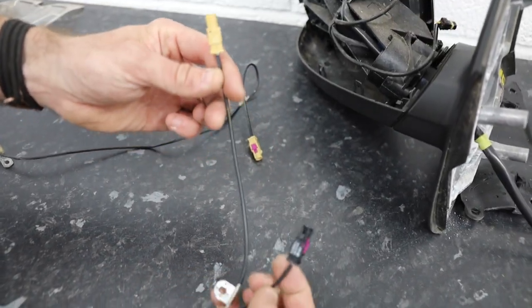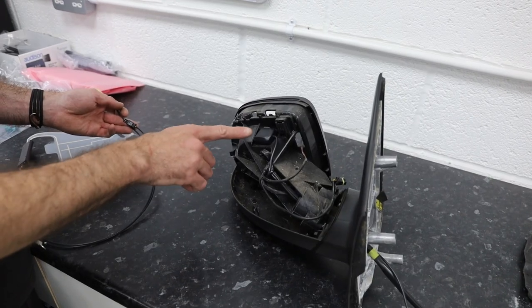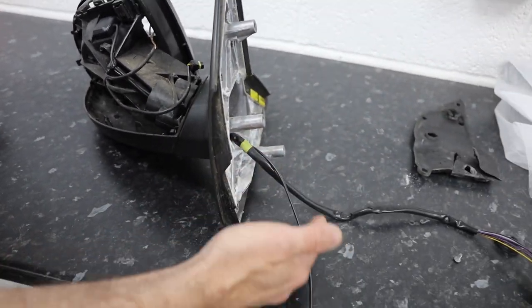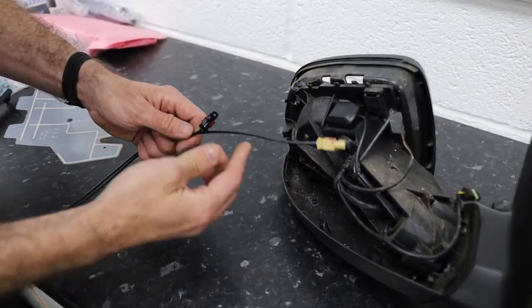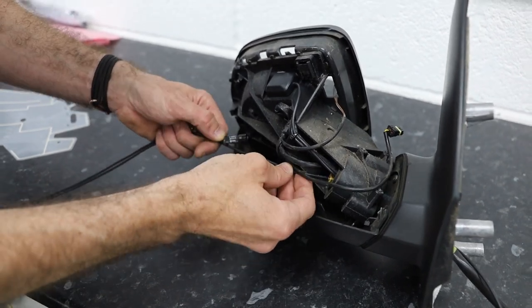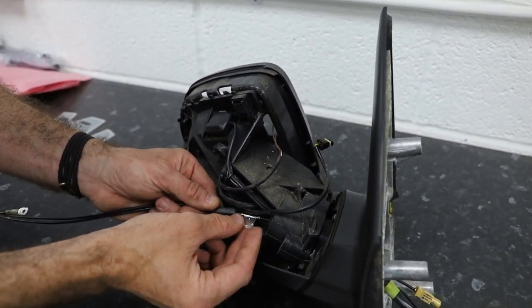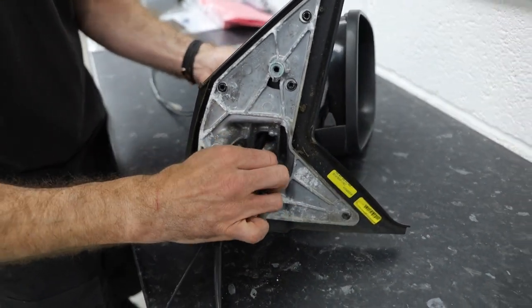And here's the new one. You've got your FM and there's your DAB. Step 18: we're going to feed your cables back through. There's also a GPS antenna here because we were doing another install for an aftermarket head unit — we'll always try to put the GPS in the wing mirror for better signal. Feed those two connectors through: that's the new FM and the new DAB. Pull it all the way through.